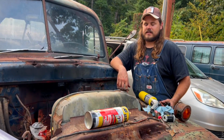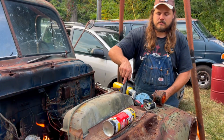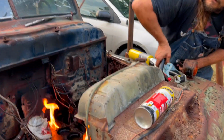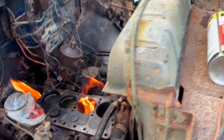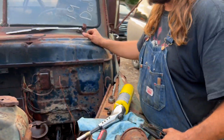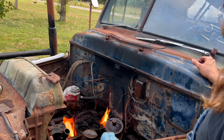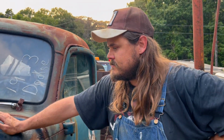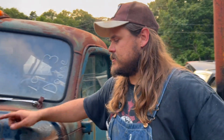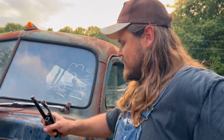Well, folks, we've wasted an afternoon and it's still no budge. And I've been keeping them alternating cylinders on fire now for about an hour and a half. And still pretty stuck. But somebody commented, dump some brake fluid down the cylinders. So we'll give that a shot. As soon as this burns out, we're gonna throw some brake fluid down it and call it a day.